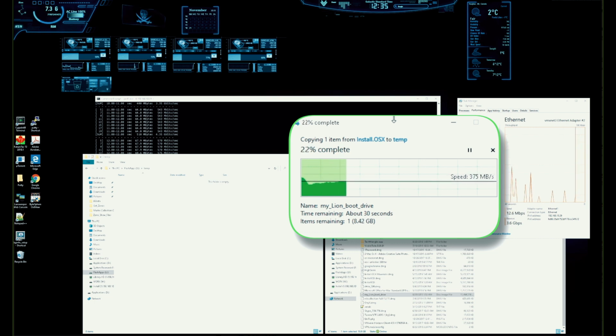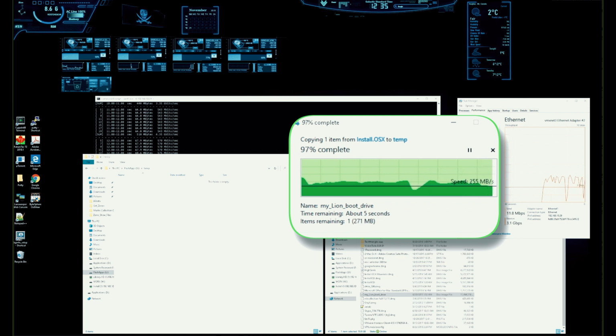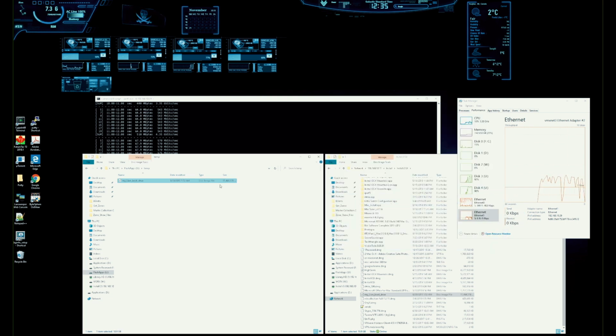360 megabytes per second, which is, I think, the average speed for flash drives, unless you're using M2, and I don't use M2 over here. So these are okay, and this also depends on how fast you can read the file on the NAS. And on the NAS, like I said, I only have 8 drives in a RAID 6 configuration, which are normal spinning drives, and I don't expect much speed over 300 or 400 megabytes per second, because it's just spinning disks and I don't have cache on that yet. So that also impacts the performance right there.